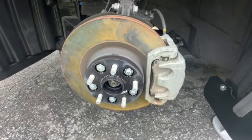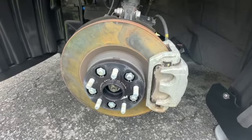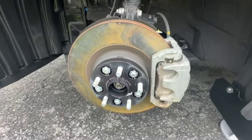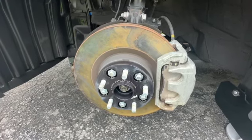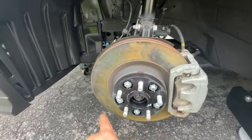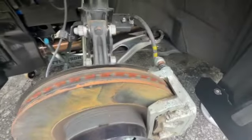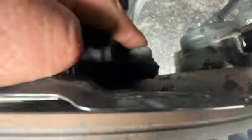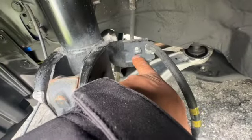The sun never came out and it's still overcast, but I'm going to try to do this anyway. First thing you do is jack up your car, put stands under it, take your wheels off, and if you have wheel spacers, remove your wheel spacer. Then undo the two caliper mounting bolts — one here and one down here — then undo this 12-millimeter brake line retaining bolt.